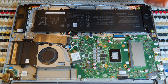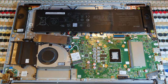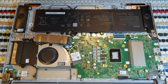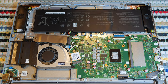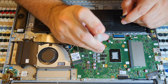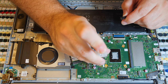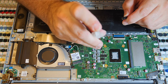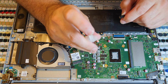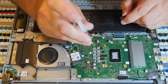So let's take a look. Okay, it looks like the paste for the heat sinks actually needs more. It is not, as I had hoped, a direct connection. The heat sink paste for these things actually has to be piled up, which is stupid, but whatever. I do not care. If that's what it takes to keep it cool, then that's what it takes, man. I'll do what it takes. The V-regs, I can see, got much better coverage, except for that one.